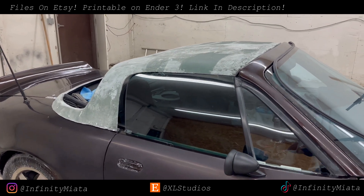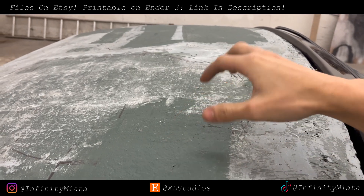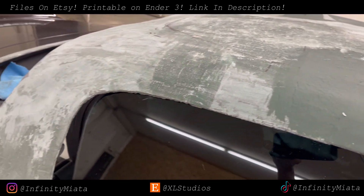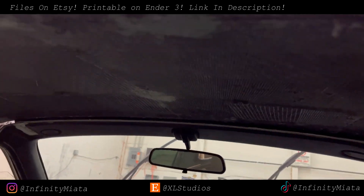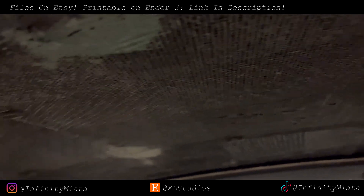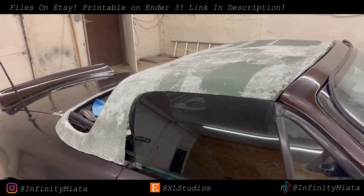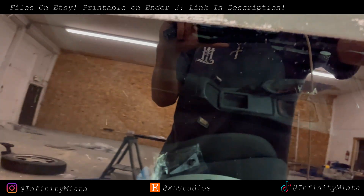The fitment is more than fitted — it just has to be body worked. When all is said and done, when the seals are added and all the putty work is done, the applications are really endless for this. I could put fiberglass over this, pull a negative mold off of it, and then fiberglass inside of that and just start replicating this design. Or if I don't want to do that I could fiberglass the entire thing. Let me show you guys the inside — it is 3D printed, and I'll link the video in the description that shows how I printed these in a mesh pattern so the putty can squeeze right in between it.